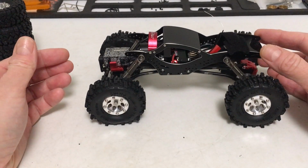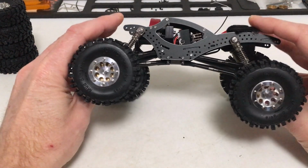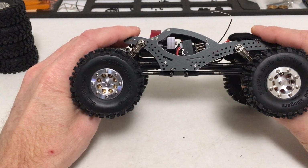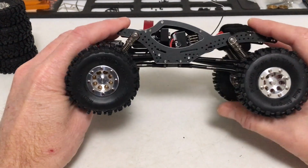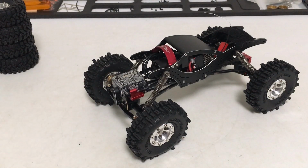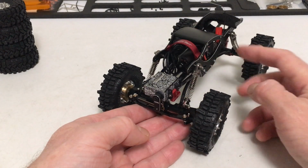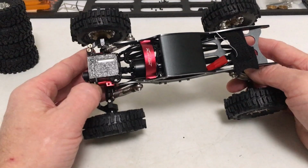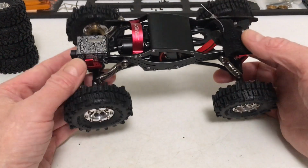The battery will probably drop it some, but I'm wondering if I can use some rubber bands to potentially bring this down, maybe get it riding somewhere in this zone, a little bit lower, keep the nose tucked. So I do have some rubber bands, so I think I'm gonna look at probably just shock point mounting those behind the shocks there, because I don't really have a good center point to go to on this frame, and I think that'll just keep them kind of hidden.